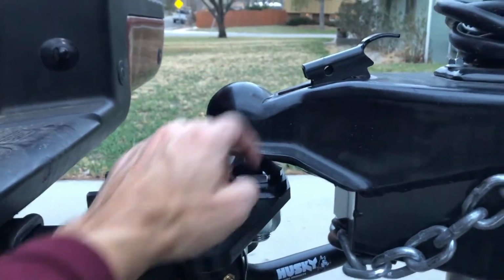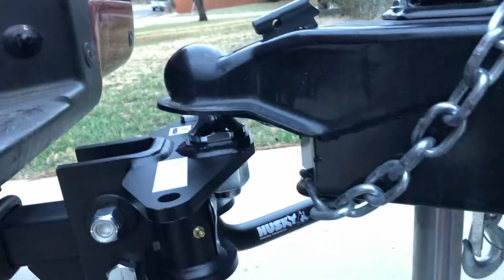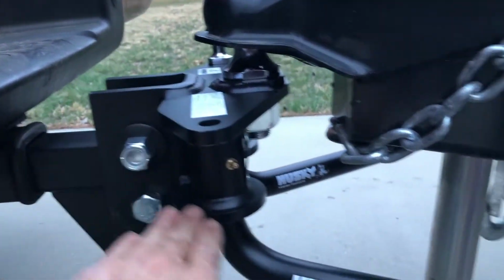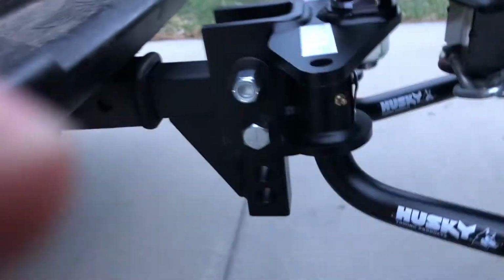Of course, we're supposed to close this off, lift the back of the truck up, then hook these on, and then go down. Something else we can do to adjust is angle this down, because we're supposed to be 6 inches from the ground and we're not. So that'll be the issue with our torsion. We're gonna lean this out. So let's do that to adjust it.